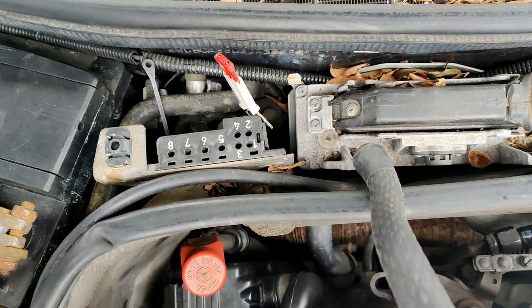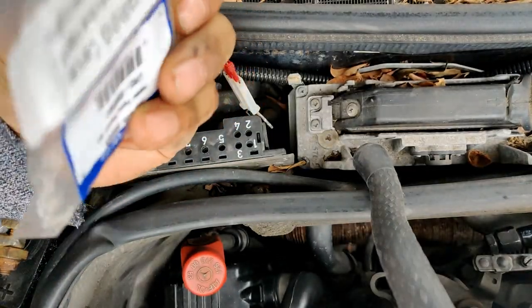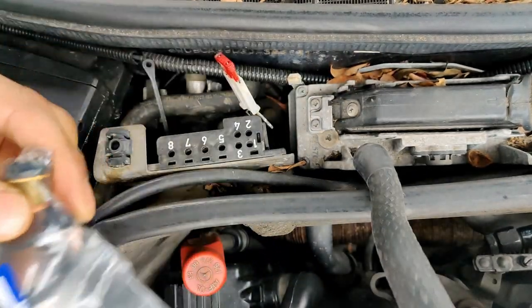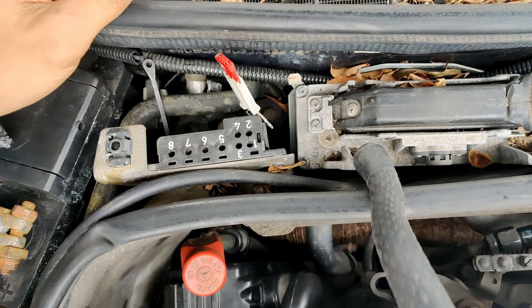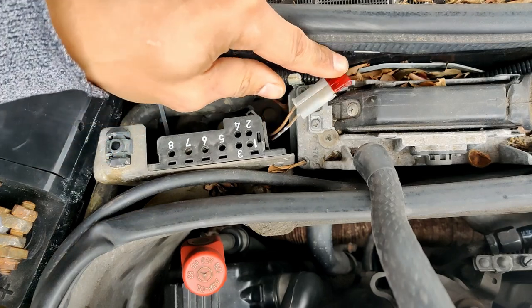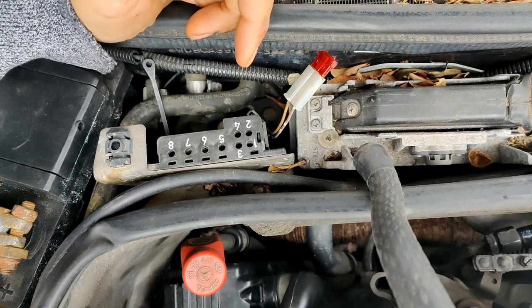Today we're going to be conquering, hopefully conquering, let me repeat, knock on a little bit of wood, just none around here, but knock on W126. Hopefully be fixing the issue of heat. And in these cars, usually it's the monovalve, and the rubber wears out, so you gotta buy this repair kit and replace this onto the monovalve itself. I forgot what it's called that you replace it onto, but we're gonna be doing that. So yeah, let's get busy.